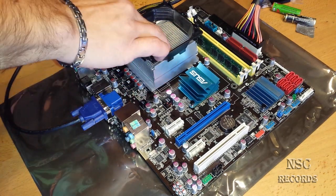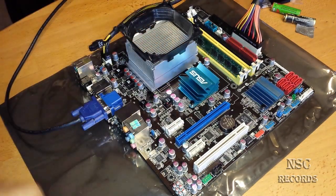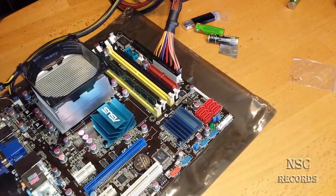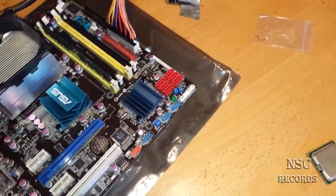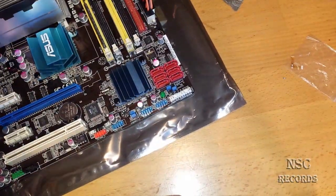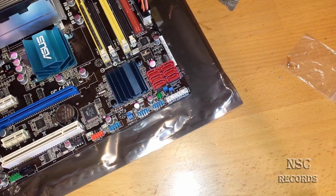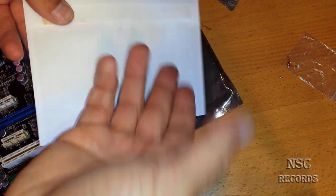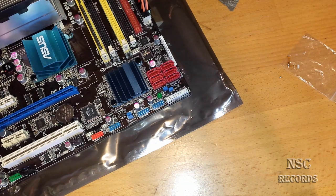Okay, now it's time for the true test. I really don't know if this processor will work, but I don't care — if not, I'm gonna do this video again when I have bought a new Xeon processor. On some motherboards you got written here the reset button or the power switch. I can see two pins — a bit not in place — just take care and fix it. These are later the connectors for your computer case. I can see the power switch: PWRSW. These two contacts are it. I need to put in some metal contact and then it will turn on.